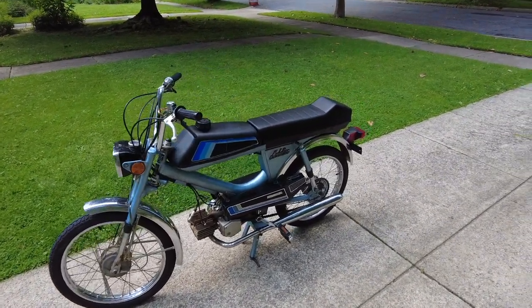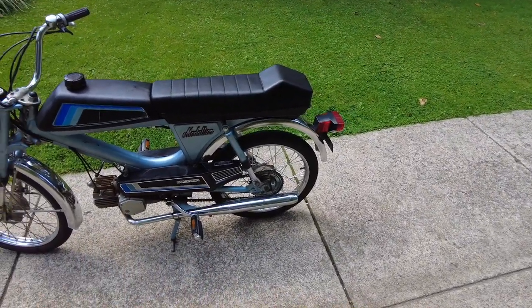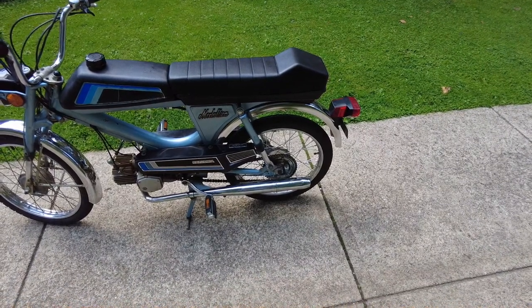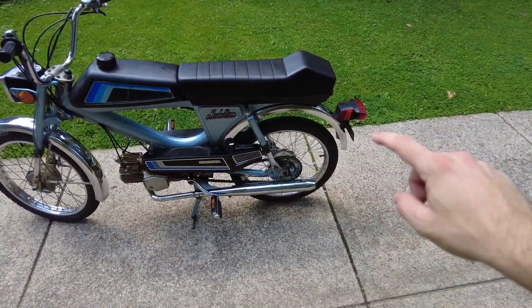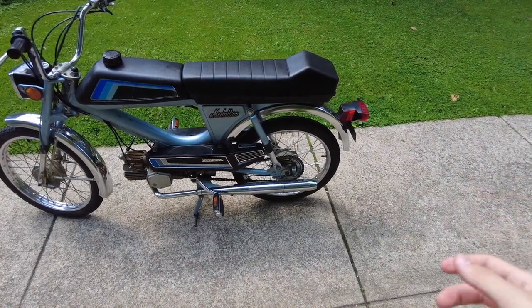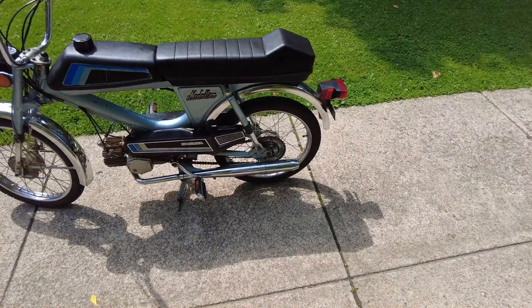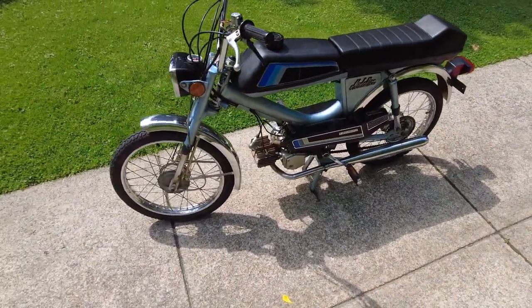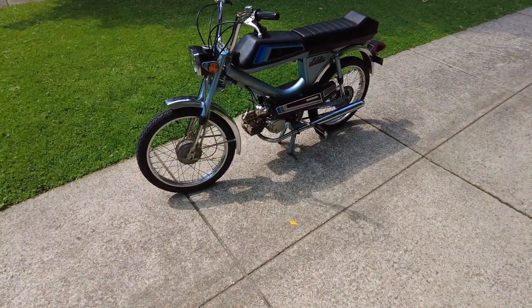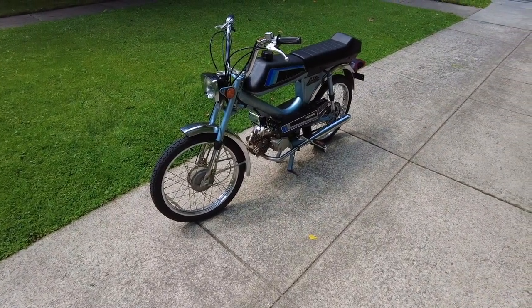The rear wheel had multiple broken spokes, and the owner of this bike took it to a different mechanic shop that really didn't know what they were doing. And the guy there installed bicycle spokes in the rear wheel, but he didn't tighten them up all the way. And so when the bike was ridden, the wheel just came apart. And because Columbia is obviously somewhat of a defunct company, and it's also kind of a unique rim with the thinner spokes, just going out and getting another wheel is nearly impossible.